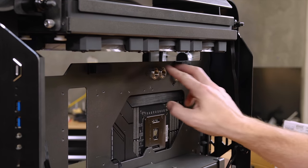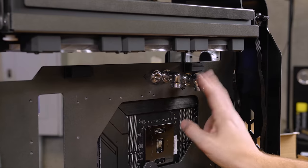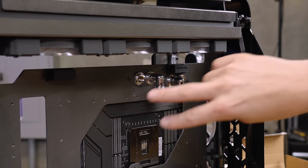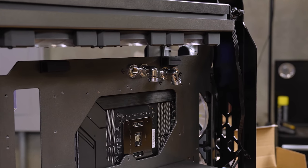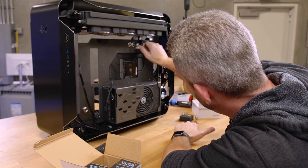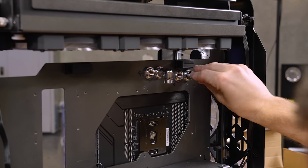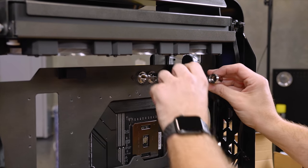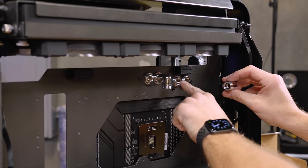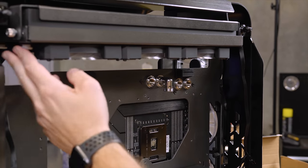So it kind of sucks that these are not on the same plane, but like I said, because of that, in and out on the CPU matter. In and out on the GPU don't. I only had this in on the GPU because the out was the taller of the two tubes that are in parallel, and I thought that'd be easier to make air move, but that's not as important. So what I could technically do is switch this so that out is there, and then use my spacers to get these up, and then that would be the in. So it'd be like that, into there. These would go over and then go out there to the GPU or to the radiator.